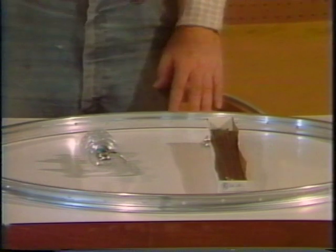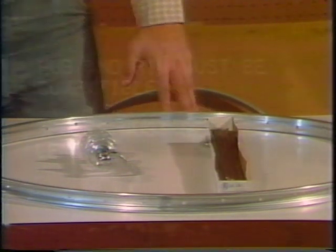Just any old hub, rim, and spokes won't do, though. You are going to have to make sure that the hub you choose and the rim you choose are compatible. And that means that if you have 36 holes on the hub, you have to have 36 holes on the rim. And you're going to have to make sure that the spokes you get are the right length for the hub and rim and spoke pattern that you pick.